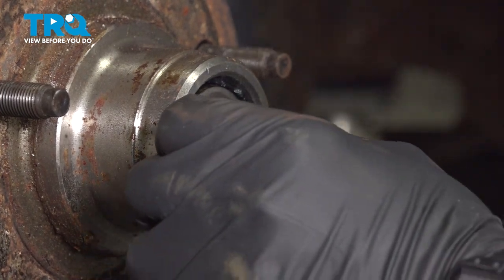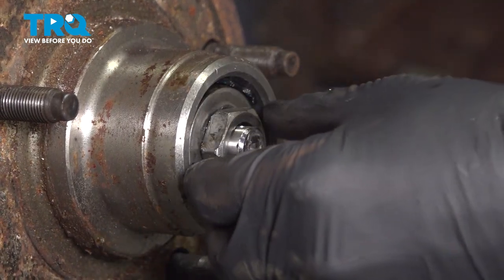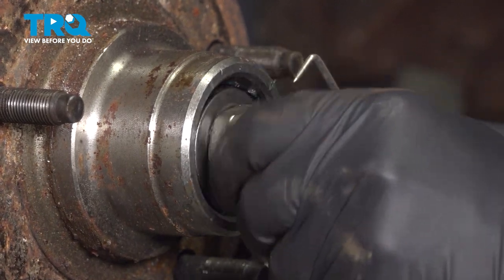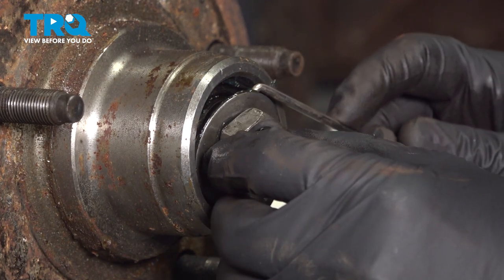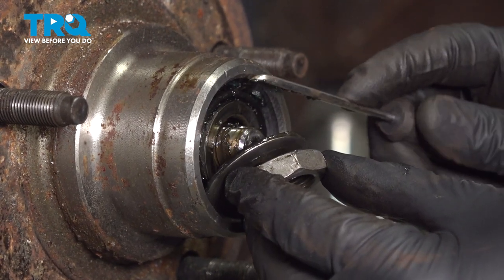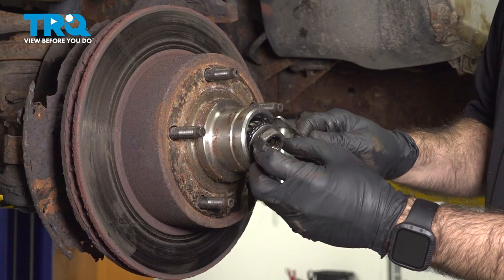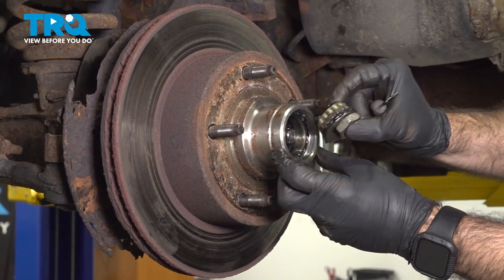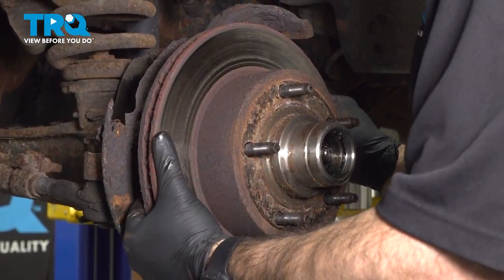It shouldn't be very tight. Once you remove this nut, you're going to want to have either a small pick or a small screwdriver handy. You're going to want to remove this nut but not take it all the way off — keep it close. Pull back that washer with it. Behind there you'll have a bearing. Once you start to mess with this bearing, your rotor will drop forward, so be ready for that. Ideally, you're going to take out this bearing, the washer, and the nut together. Once you've removed those, you can take your rotor and slide it right off.